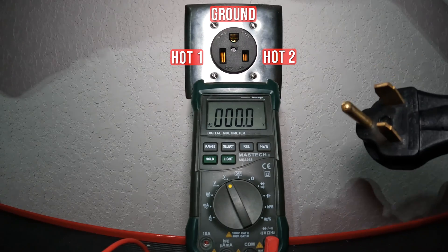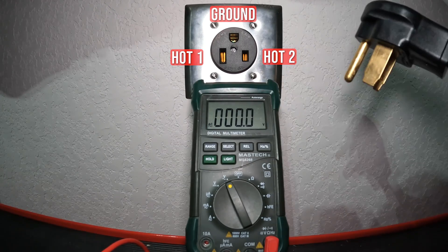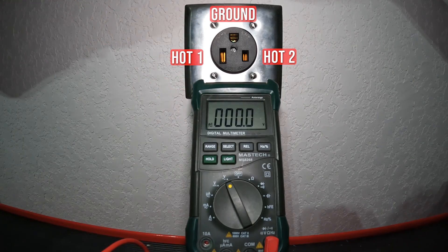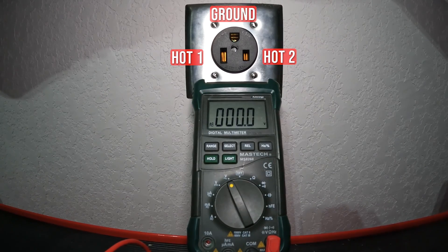As you can see here, this is the plug that would actually plug into an outlet like this, and I already have my meter here in place, which is the easiest way to test this. But if you notice you have an issue where you're not getting power to your device, I always recommend double-checking your circuit breaker — make sure the breaker hasn't tripped — and then you can go ahead and test this voltage to verify you're actually getting 240 volts.